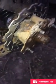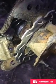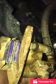Next thing, after you remove your two bolts, you go ahead and slide that brake caliper off. Right now is a good time to check your brake pads. I usually get about 2 rides out of mine. So I buy these cheaper name brand. I've used EBC and Caltric and Centric something. I can't remember the names of them. And they never seem to last me in the mud and water, as much as I go through it. So I just buy these cheap name brand pads. They're like 10 bucks for both sides, and they keep me running. I keep them in stock. I change them out like every 2 rides.